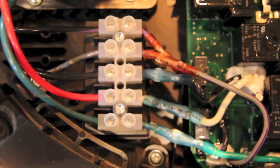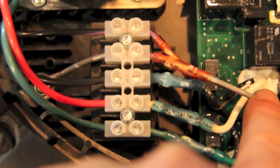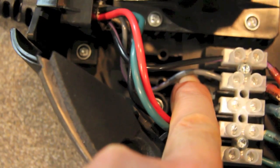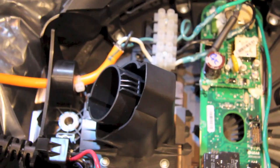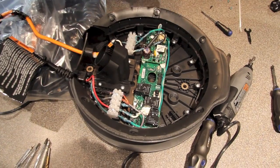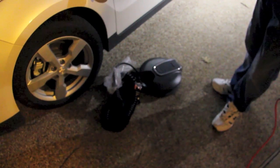This is what the car connector portion looks like. The wiring is: green to green, white goes to red, solid black to solid black, gray with the purple stripe goes to gray with the purple stripe, and black with the purple stripe goes to black with the purple stripe. That's the power cable out of the 120.